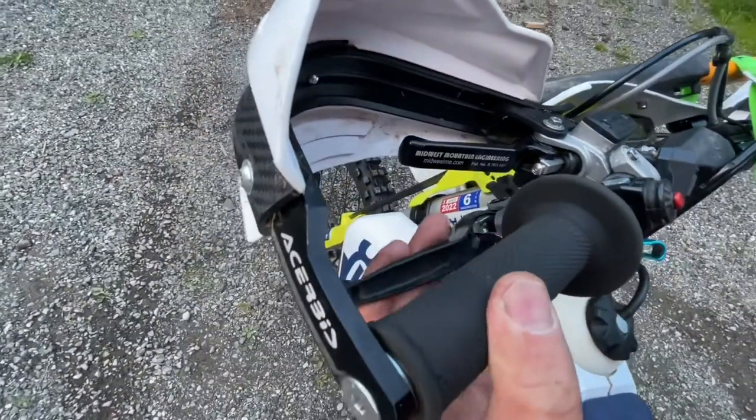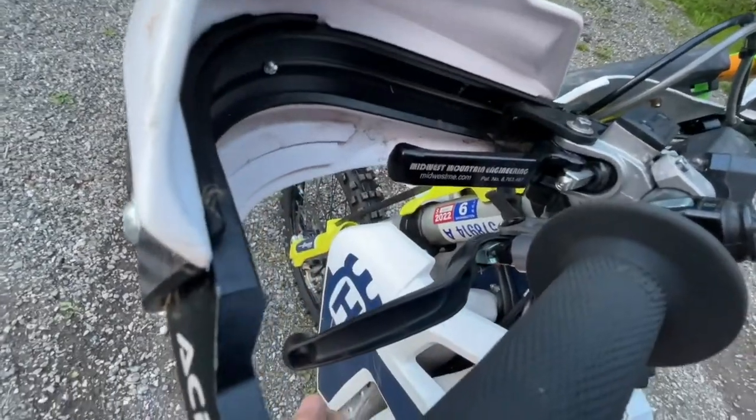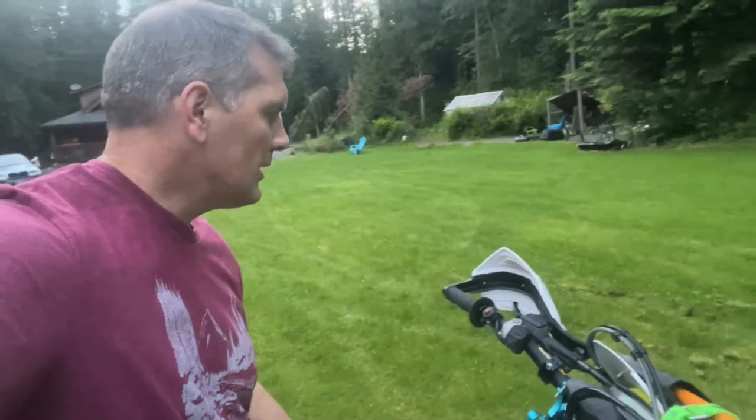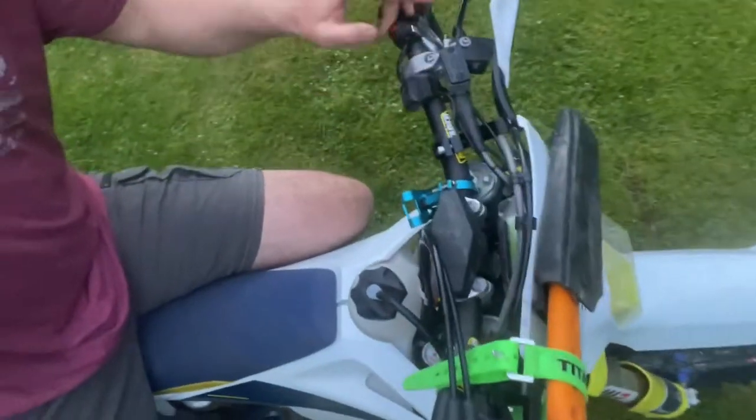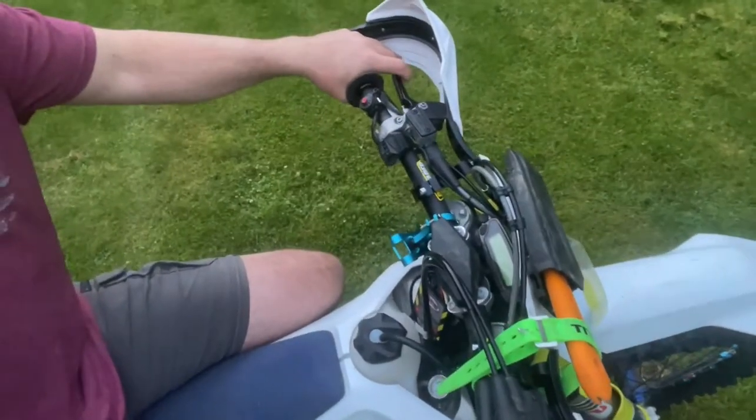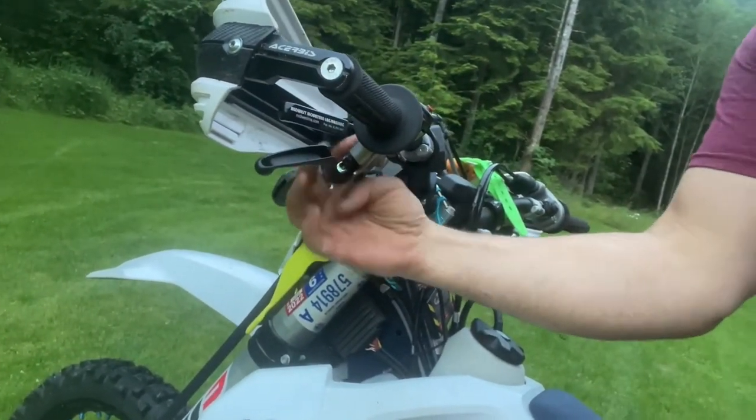This is the setup and I'm excited about it — definitely explore this option. I think it's worth the $450 or so, which I paid out of pocket. It's not an endorsement — no affiliate links or any of that. Final thoughts: don't ever let equipment mask a deficiency. I am getting away from using the rear brake, going more toward the Ryan Hughes style of riding on my toes. Play with the setup, adjust the clutch inward, get used to that first finger, and adjust the angle so you don't pinch your finger. I think you can add another dimension to your riding. Have fun — cheers.